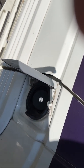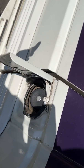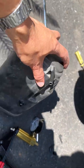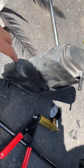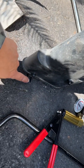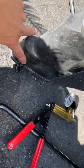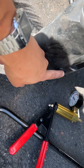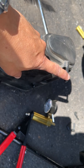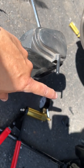What I found is that there's a tube that goes from the gas tank to this evaporative container here. This particular container only has one input and then vents to the outside world. This is a little different because normally these things have at least three connections. These little nubs here are just for alignment and don't connect to anything, and the intake manifold input is connected via a T out onto this single hose.